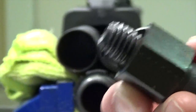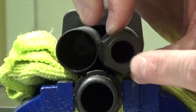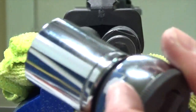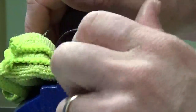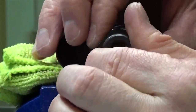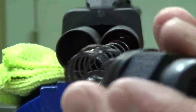Now the follower nut tool is free — go ahead and do the same thing to the second mag plug. Get the two tips to locate right inside the follower, thread the bolt in by hand until good and snug, then give it a little quarter turn with the 3/8-inch allen key. Take the 7/8-inch deep socket, locate it on the follower nut tool, and take it off. Be careful — it is under tension as you get to those last few threads. There's the spring.